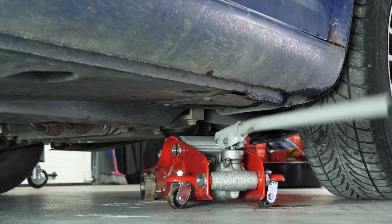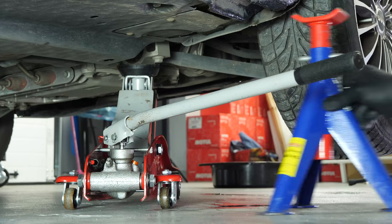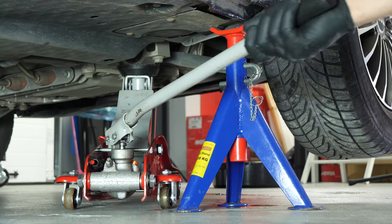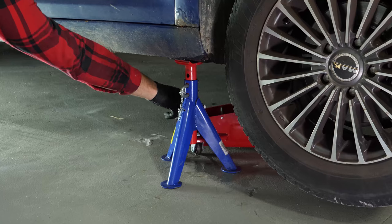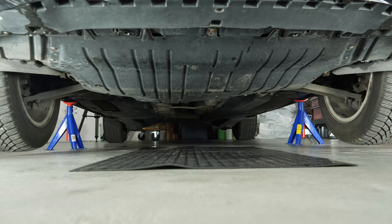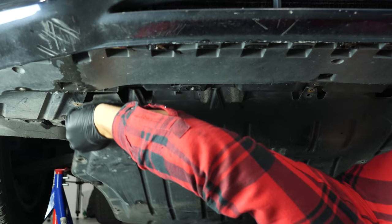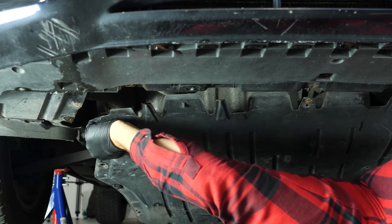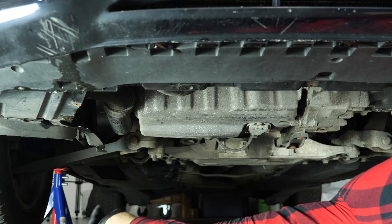In order to drain your vehicle, you must first lift the front section of your car. This will enable you to access the drain nut. Lift the front of your vehicle and put it on the two axle stands. We strongly suggest watching the tutorial on raising your vehicle safely before carrying out this step. If the front plastic crankcase is present, you should now remove it to have full access to the drain nut with a socket wrench and a T25 Torx socket.